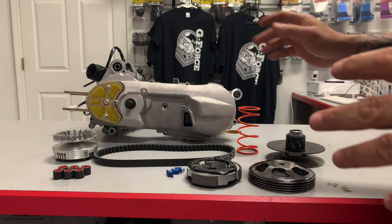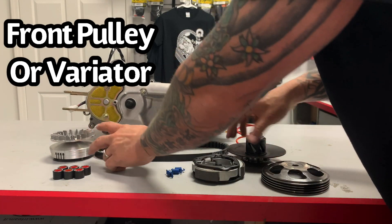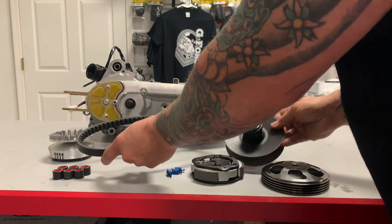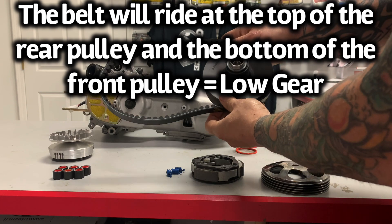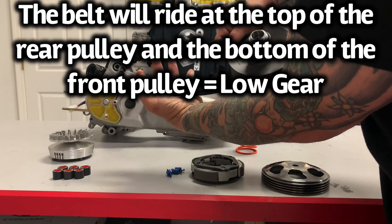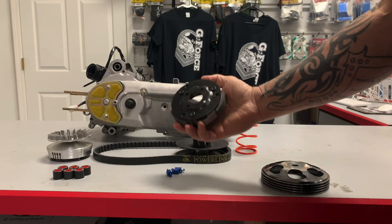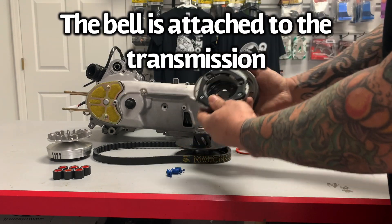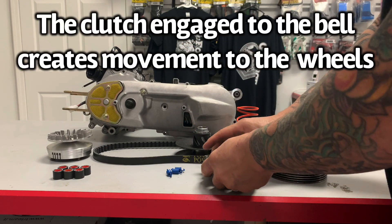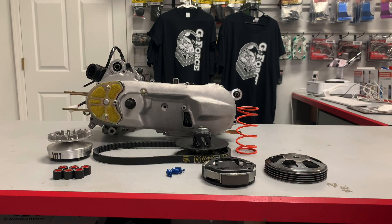Basically what we have here is the CVT system — I have everything taken out for better viewing. You have a rear pulley, a front pulley, and a belt. The belt starts over here, and when you're in low gear, the belt is going to be all the way at the top of the rear pulley and all the way down in the front pulley. The motor turns, you create RPMs, and the centrifugal clutch with its three shoes — as this turns more RPMs based on the weight and adjustment of the shoe springs — it will open up and grab the bell, which will now drive the ATV.